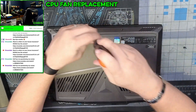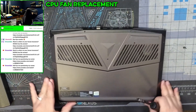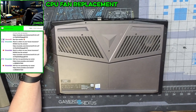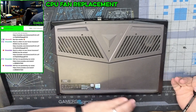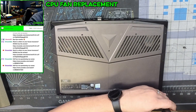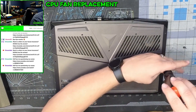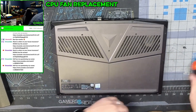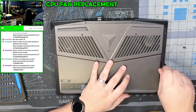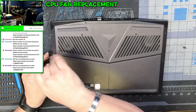So what we have here is a Lenovo Legion Y545. We're going to go ahead and take it apart. On the bottom we have thirteen screws — just standard Phillips head screws. There are some different lengths here; the fronts are a little bit shorter, and it's a kind of a narrow channel for these screws to fit into.